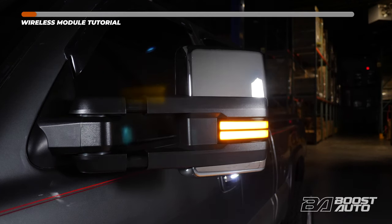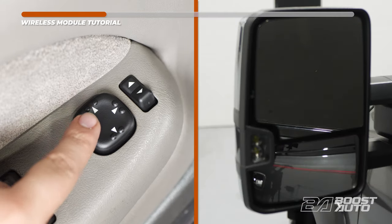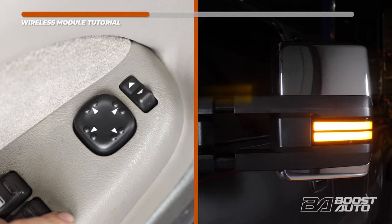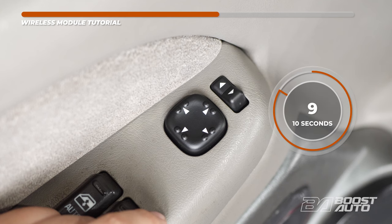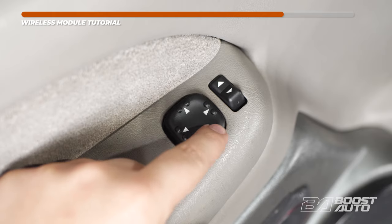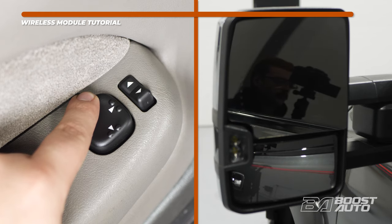Here's a little more about how to use the wireless feature. To begin, activate the modules by selecting the left mirror, then use the left-left, right-right sequence to activate the module. Once you hear two fast beeps, the modules are activated. While the modules are active, the mirror glass will not adjust. Once activated, you may power fold — tap up to fold the mirrors out or tap down to fold the mirrors in. You may see the passenger side mirror start folding slightly after the driver side due to the module communicating side to side. To deactivate, you have two options: let the modules time out — if there is no activity for 10 seconds, they will automatically deactivate — or deactivate manually using the left-left, right-right sequence on the mirror switch. You will hear three fast beeps once deactivated. Once deactivated, any left-hand mirror adjustment will be slightly delayed to prevent erratic manual activation.